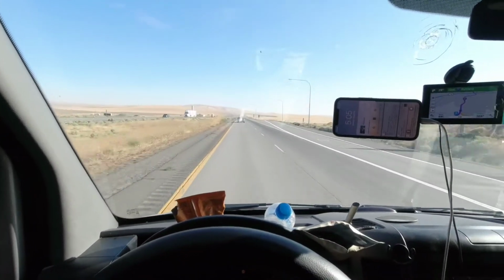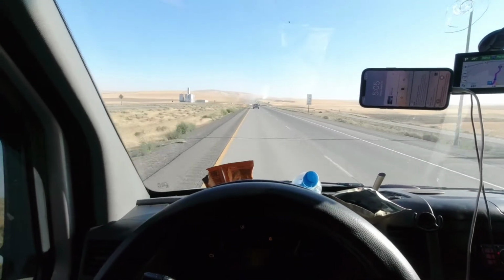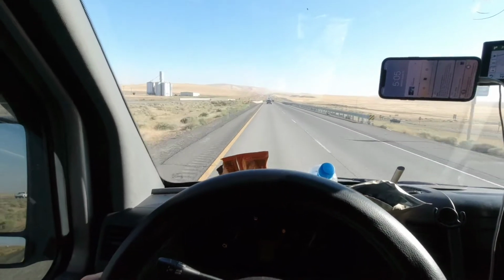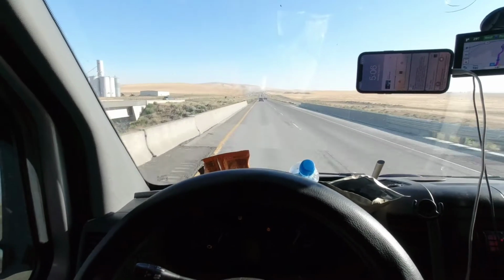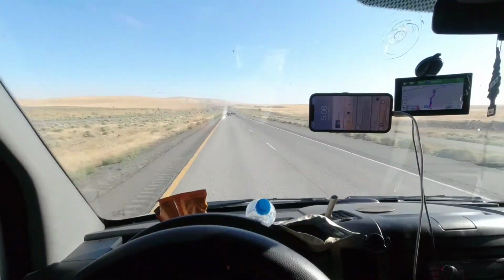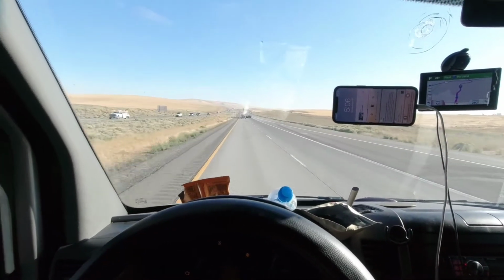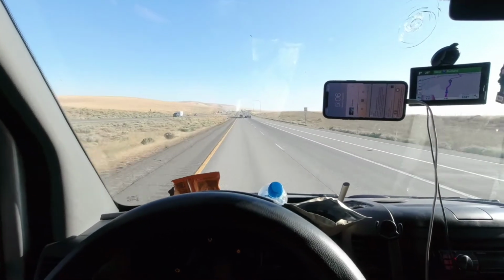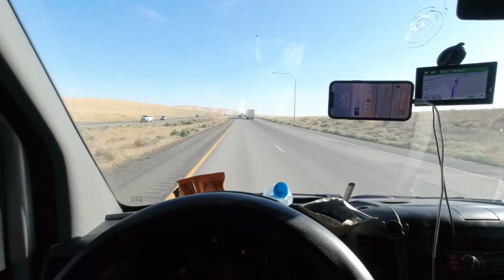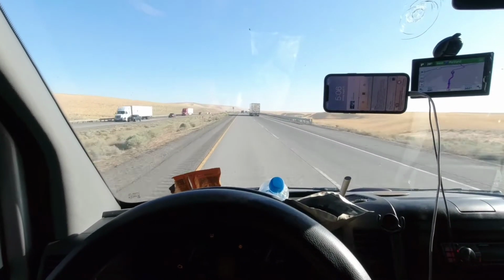I just filled up. I am at a decent speed, so what happens is I've kind of researched, well, not researched, but got used to how this van operates right now with it being broke down. And what I need to do on my end to keep it driving at the speeds that I need it to drive at. So basically the trick is, every time I have to start it with the starting fluid, doesn't matter what, because the pressure in the rail system disappears somewhere, so it's not there. After that, I gotta not go on any lower speeds than like 65-ish or so. If I do that and maintain that kind of speed, I'm okay.